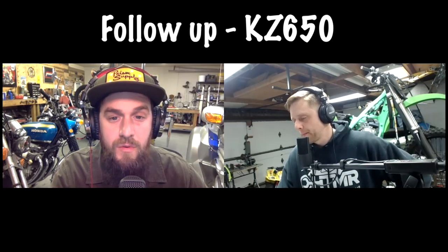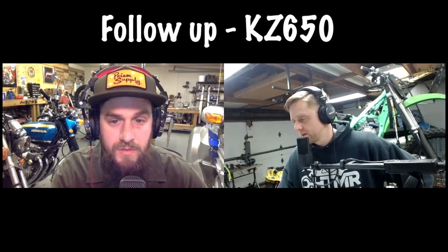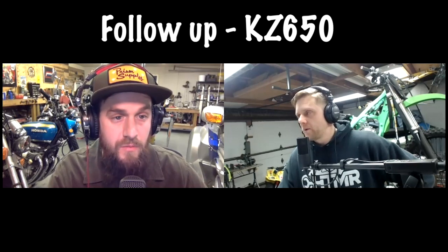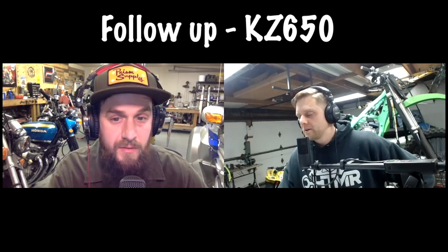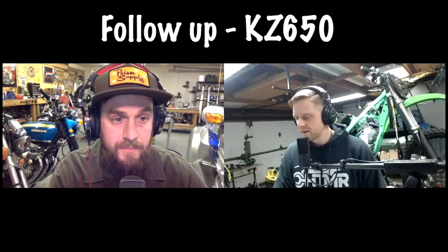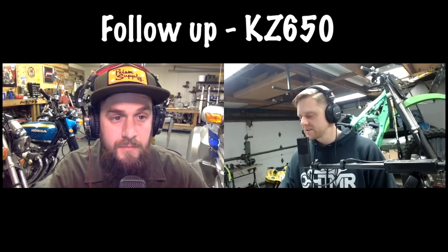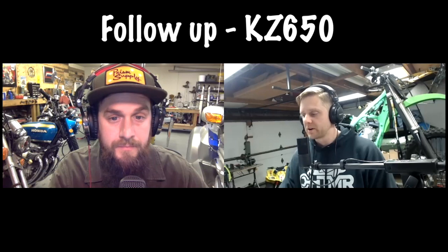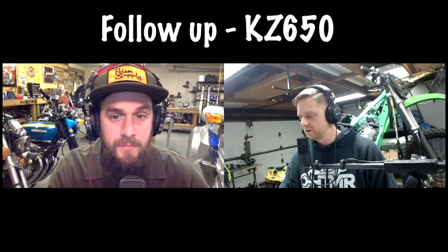We also don't know how it ran. That's true. So we're trying to diagnose just a simple carb tune for what he's got, not knowing how it's responding currently. We're trying to jump 10 steps ahead here. Exactly. To be safe on the pilot jet, probably just run stock and see where your air screw setting's at, because again, it's a 70s bike. Needle, yes, drop it down one clip to make it richer.